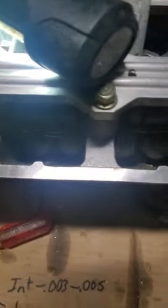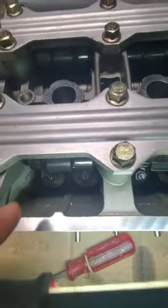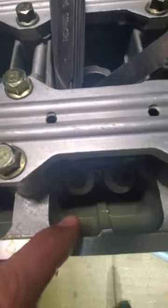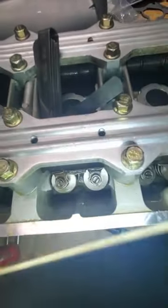You don't turn the screw to tighten it. All you're doing is adjusting your lash with the screw, and you're going to hold that still and then turn the nut to tighten the screw down. So do not turn the screw to tighten anything down. It's your lash adjustment screw — that's all it's going to do. Your nut's going to tighten everything down. So remember that.